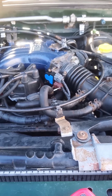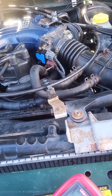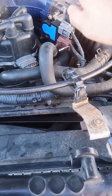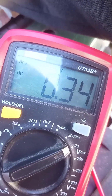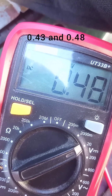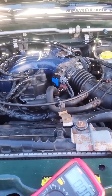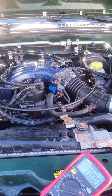With the new TPS sensor in, I did have to clean out some corrosion to get this thing to actually pop in, and I sprayed a little bit of liquid wrench on it. You leave your pin in there the whole time. Loosely tighten the bolts so it doesn't come out, and then you can shimmy it up and down to change where your idle is going to be. The numbers you want are around 0.48 volts — you want to be somewhere between 0.3 and 0.8. I've got this tagged to the ground terminal; it's just easier and gives a better reading. This should be sufficient to get it started, and if I feel I need an adjustment I'll just shimmy it a little bit and tighten the bolts back down. I'll let you guys know.